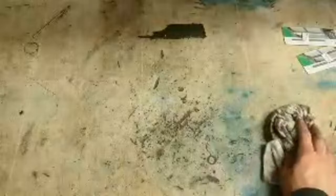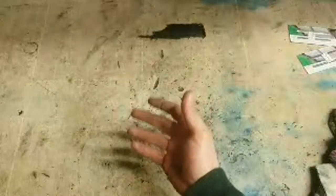Grinders, unless you're doing extremely light use, you wouldn't buy a brush grinder now. When it comes to power tools, the difference between brushed and brushless, in a drill or something, you wouldn't really notice it a whole lot. Bit of extra speed, bit of extra sharpness out of the motor. But when it's a grinder, the difference is night and day. A brush grinder's grand, does the job, but a brushless grinder, way more power, way more speed, way faster to use. There's no comparison there.